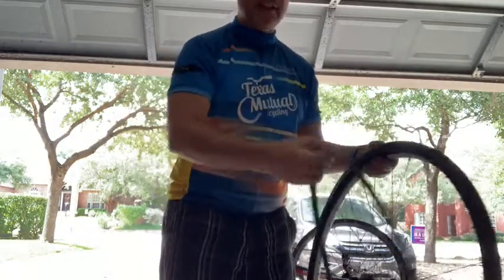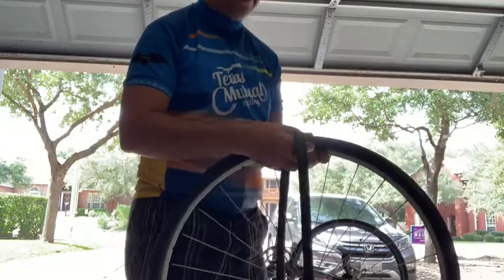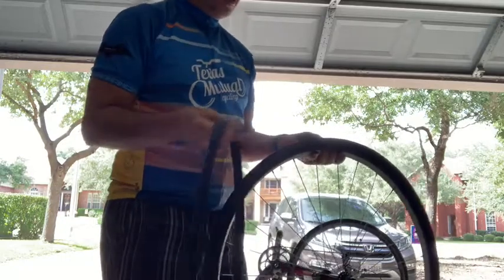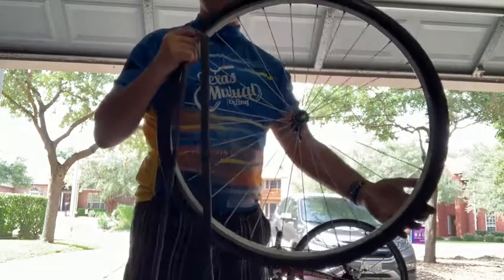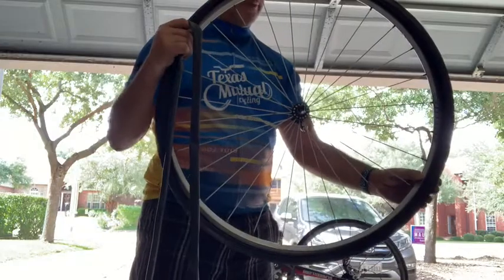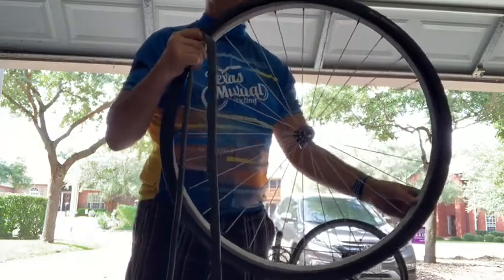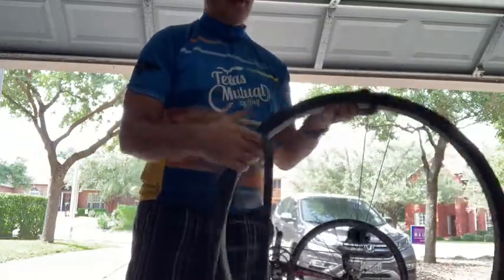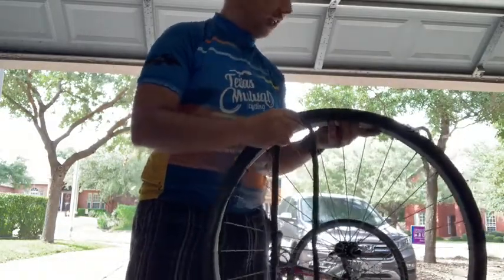Okay, so hopefully you've figured out what caused the flat and you've removed it. If there's a little bit of glass inside the tire, if it's a little bit of wire or a nail, you've removed those. The other kind of flat I did mention was a pinch flat, and that can happen when you hit a bump or a kind of a sharp piece of curb in the road, and what happens is the tube is pinched inside the wheel, inside the tire, and loses air. If you get those, then obviously nothing on the tire caused it. It was just you were unlucky.